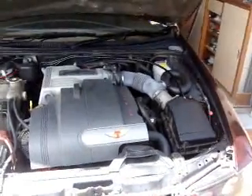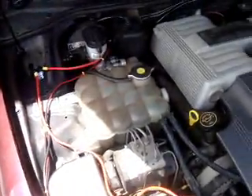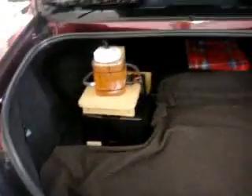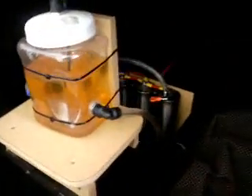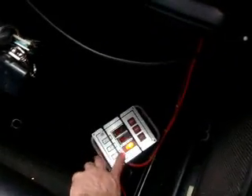So that's the engine. Just idling it seems fine. It's a 130 amp alternator bolted on there, so there's plenty of juice for it. Underneath the alarm is where we drilled the hole in the firewall to go straight through. I'll turn it on in a sec just to show you the bubble flow. Because it is in the back of the car, it does take a good 30 seconds or so for the gas to reach the engine. The top switch doesn't do anything - it's not wired. We were going to have a little water flow pump but we didn't need it.